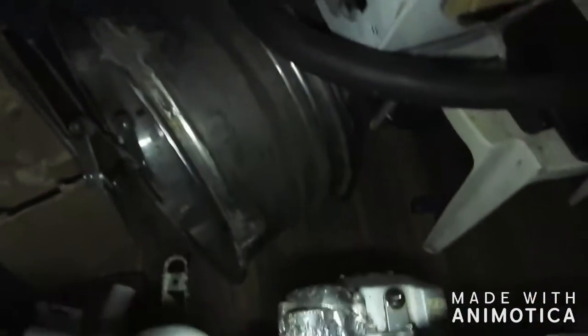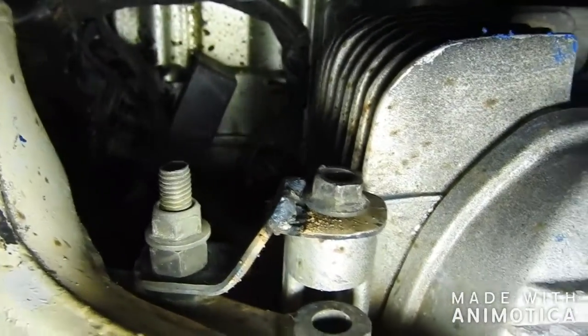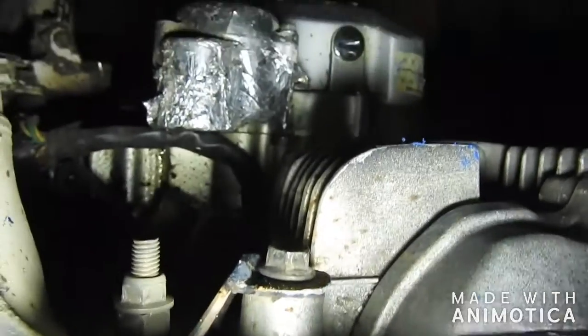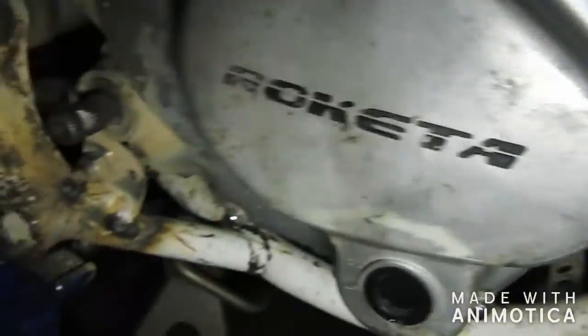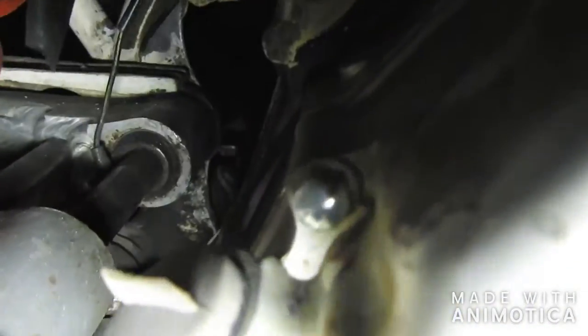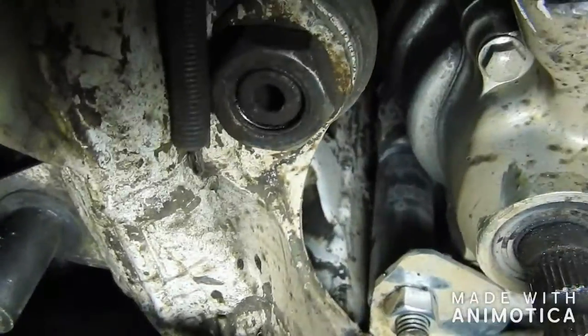and then the other side, we're flipping upside down on the camera. I had to bend it out because the side of the motor sticks out further. I made a little tab, welded it on, slid the bolt through, tightened it up. It's good to go. Bottom motor mount, same thing, bolt all the way through. Good to go. The lowest one, it's the second motor mount here, but I didn't feel like making long braces, so I just went with the bottom one.